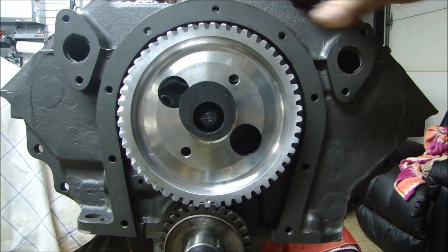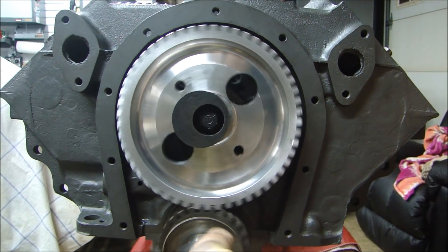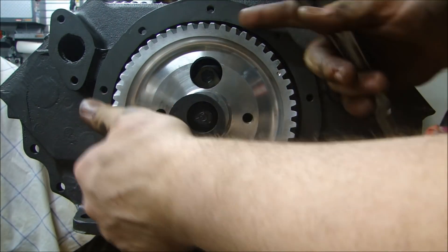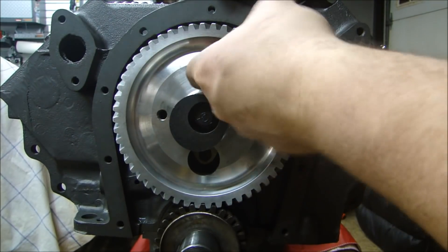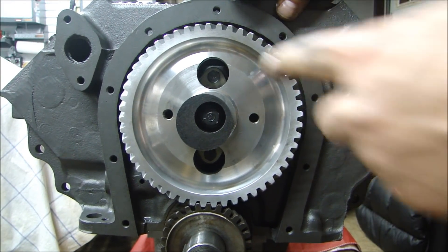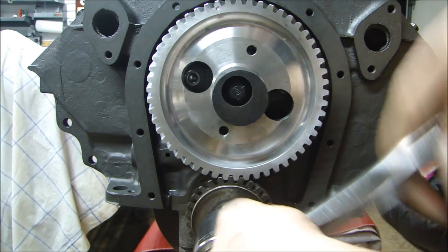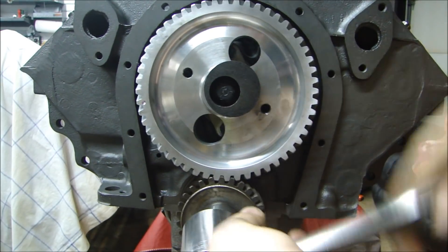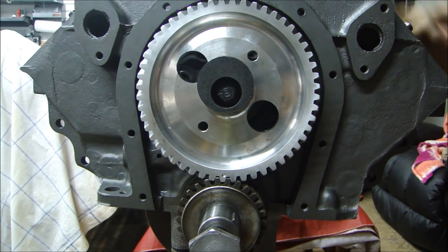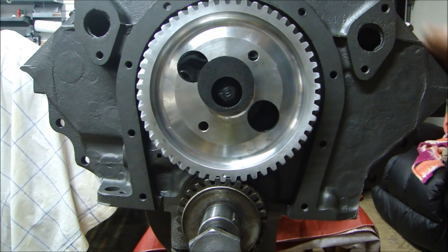The timing marks are aligned, the top gear is in between the two marks on the bottom crank gear, the eccentric for the fuel pump is going up, piston number one is at top dead center, and both lifters for those cylinders are down. I left the plate loose so I can turn the engine over — the holes will line up with the two plate bolts. I checked the cam end play — it felt like about 6 thousandths, and I measured it at 6 thousandths. Now I can go in there, tighten those bolts up, turn it back around, and the timing marks line back up. The entire valve train is timed — the timing gear is timed with the crank and the pistons.